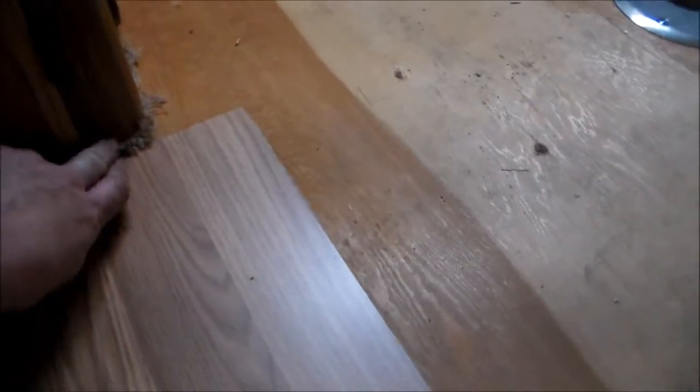This is the flooring that I'm going to put in. It's just laminate flooring from not Home Depot, from Lowe's, and as you can see here, right about from this spot here, I'm going to rip this down on the table saw to one, so it looks like one board. I'm going to line that up right here with this, and then come straight across.